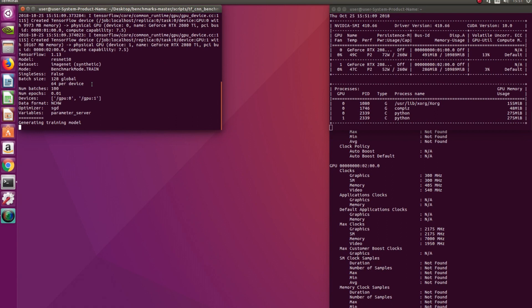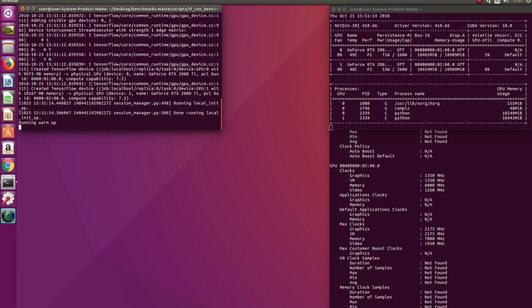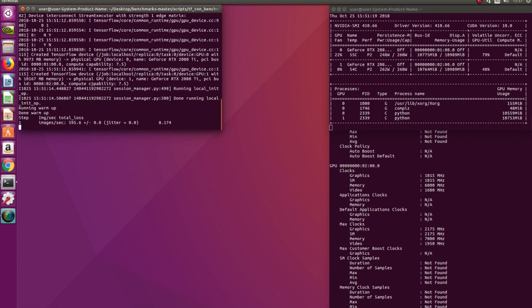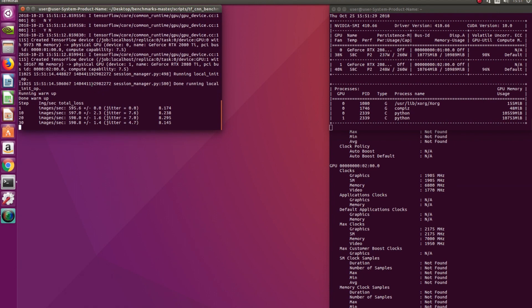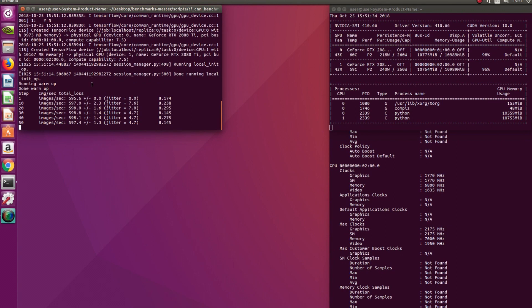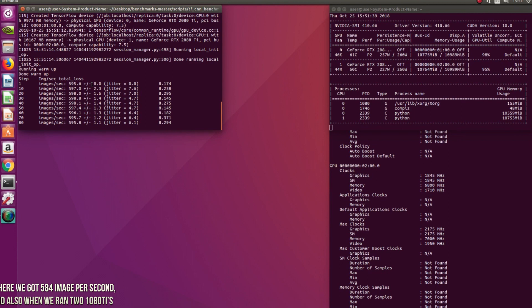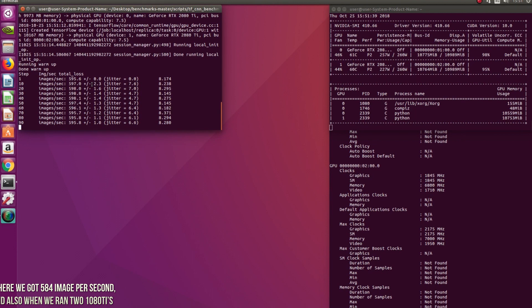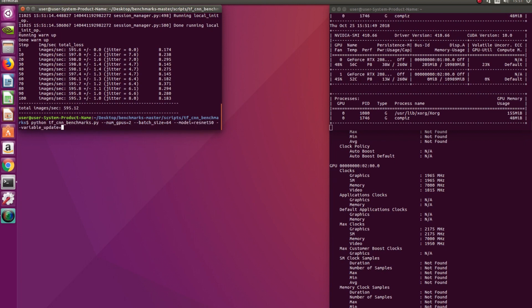Now we will launch TensorFlow on the two cards where the NVLink is installed. To find out if it is enabled, a simple nvidia-smi command can be used. We are launching nvidia-smi, where we can see that NVLink is installed, and here we can also take note of the OS. Now we are launching TensorFlow itself and we are getting 606 images per second as a result at normal accuracy. This is higher than when running a test without NVLink, where we got 584 images per second, and also when we ran two 1080 Ti's, which got us 430 images per second. From that, we can deduce that NVLink is not crucial to the result, but there are certain aspects where it is useful.